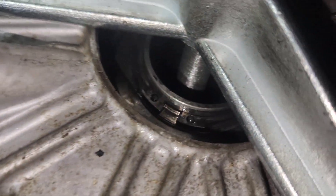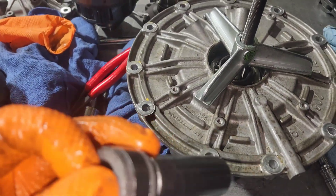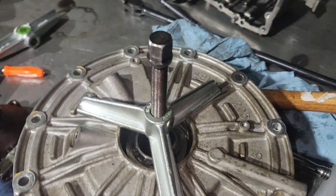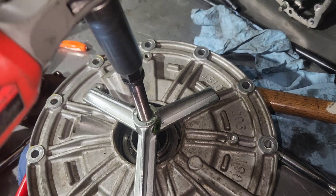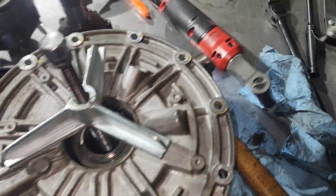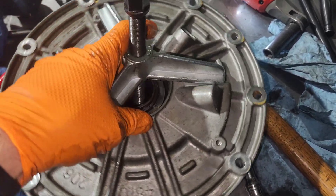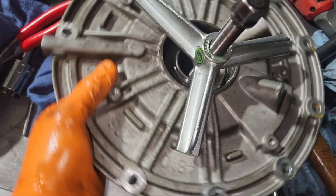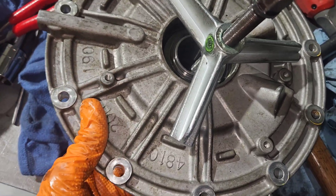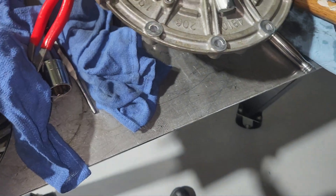Now it's back on there, it's down in the clip. We can remove the pressure from the spring and the puller — and it very easily goes down. You'll see how easily I can just hold it against my belly and pull it loose. If you're cranking this down too tight it's going to pop the middle of this out and break it. Now it's all reassembled — this should easily spin independently but stay tight with no wobbling. Take that nut off and you're done.